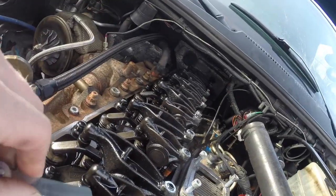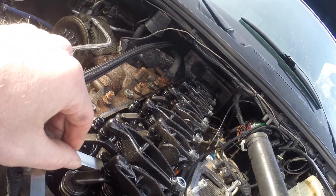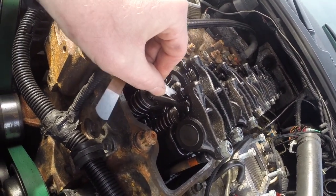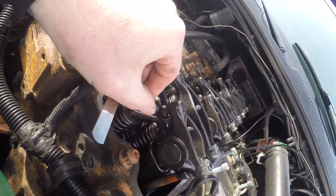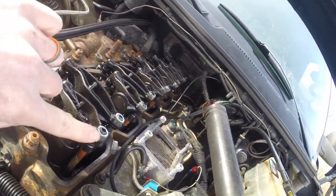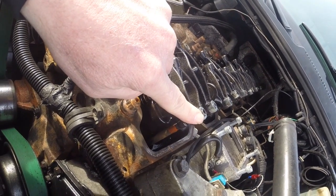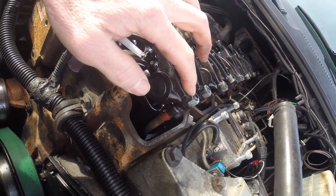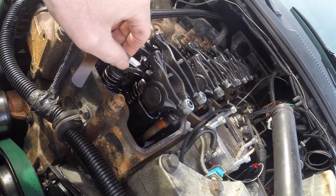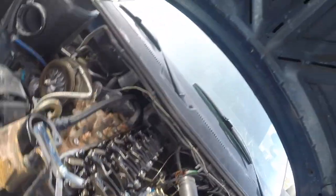The intake is ten thousandths. What you're actually going to be measuring is right in between here — you just want just a little bit of grab on there. You can see that one's pretty loose. To tighten that up, you'll loosen this lock nut, which is a 14 millimeter, and then this is an allen head — I believe it's a 5 millimeter — and then you turn that until you get just a little bit of drag.